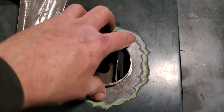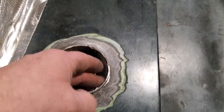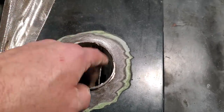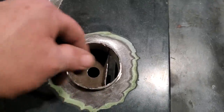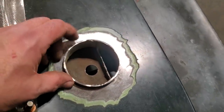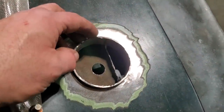So as you can see now, if it's down there doing the grinder on the stone that way, you're taking up a lot more area. So you just take your time and move back slowly, a bit at a time, test fit it, grind it again, right? Trying to do that freehand with a die grinder is very hard to do. That's why it's always good to hold on to them old stones as they get smaller. Great for doing jobs like this, right?